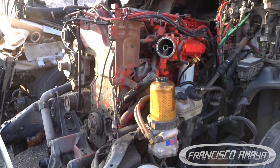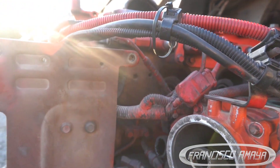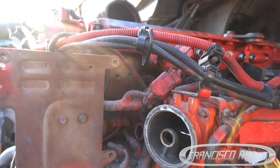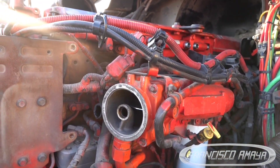That means you need to do an engine overhaul or at least do a cylinder head replacement on your Cummins ISX. If you have problems with your Cummins ISX or X15 engine, double check the cylinder head. If you've already checked it and have no cracks but are still losing or overflowing coolant, you have a different problem. Make sure to check the head thoroughly, and don't check just one cylinder — in this case we have six cylinders, so check all six. Don't stop at one that looks good.